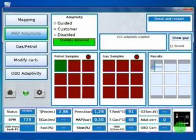It will take longer, so this part will be fast forwarded, and because this must be a little bit accurate, it's supposed to be done without the laptop connected, because it's not needed. And when we are on petrol and we have enough samples, the ECU will switch automatically to gas, and we will hear a beep sound from the switch. So now I'm starting to drive, and we will see how much time it takes to have all the samples we need, and then we will switch to gas automatically.